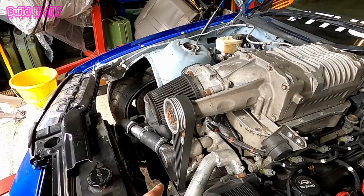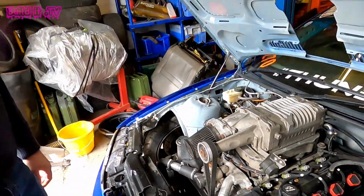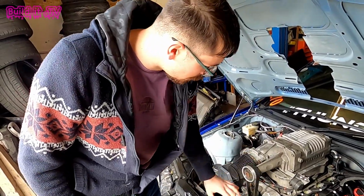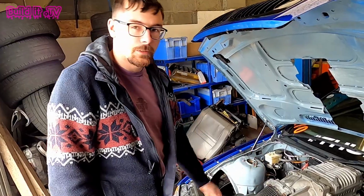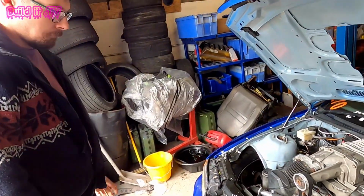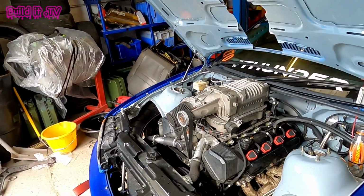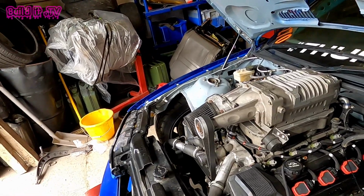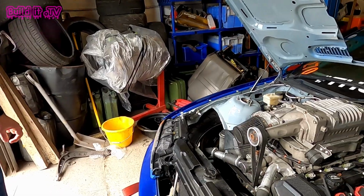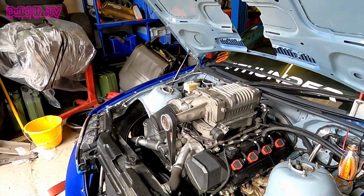So obviously the belt system is all effectively custom. Well, everything from there below is standard, right? Yeah, this is actually the standard belt off of that engine. Normally it would have air conditioning, and it's that standard belt length. Front mount oil cooler, power steering cooler, always good for a drift car, big radiator, upgraded coil packs.